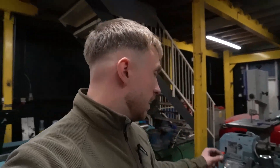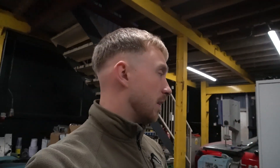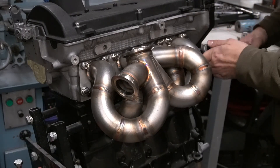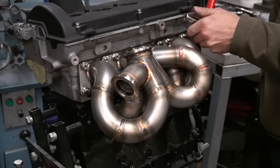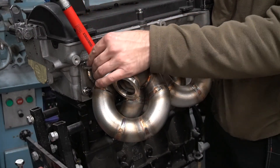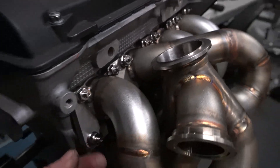That's the titanium stud and nut kit installed on the engine. I'm just going to quickly pull off this masking tape that was stopping anything from getting inside the valves, and now I can put the manifold on and it can stay on there for good. I'll tighten it down — I'll nip up as many as I can by hand to get a feel, and then torque it all down. Torque wrench set to 18 foot-pounds.